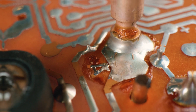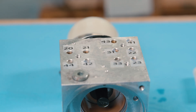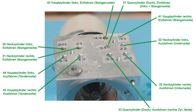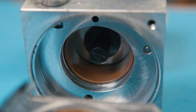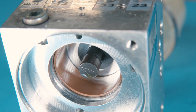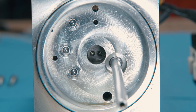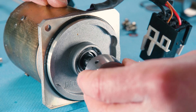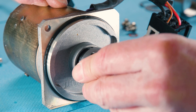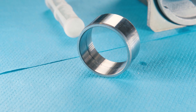Back to the pump — to satisfy our amateur curiosity, we also opened a spare pump. From the motor side, the square part is the valve block up here with the line addresses. The annular pump element is removed here, allowing a view of the stationary central hollow pin, which has a suction and a pressure channel. We've attached the rotating pump element to the electric motor for demonstration. The pin-shaped, radially inserted piston is one of three — eccentrically positioned, it is surrounded by a rotor ring showing noticeable wear marks from piston contact on the inner side.